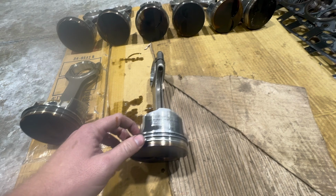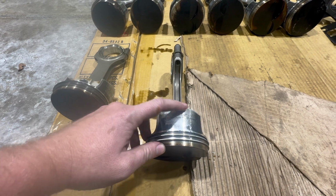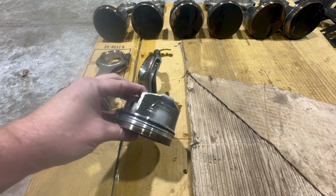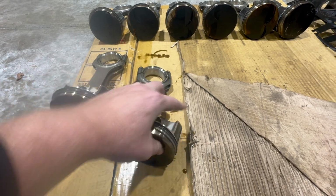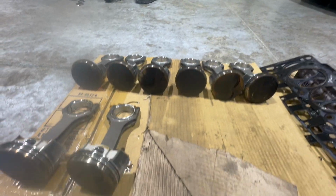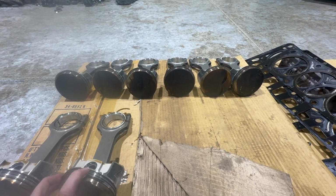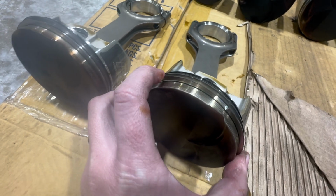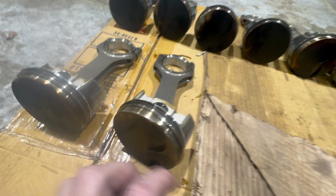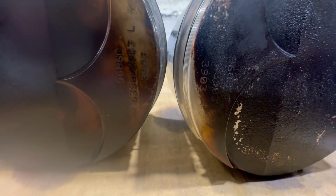This is also the one that's right next to the crank position sensor. And you can see what the piston skirt looks like on that side. That's generally what most of them look like. There's that side. But definitely got some oval shaped cylinder walls probably in there. But man, all the piston ring spring back and stuff, look at that free gap, is awesome. Just had some water coming in on a couple of them.